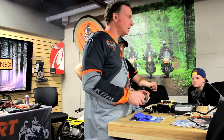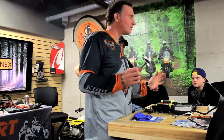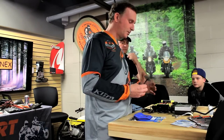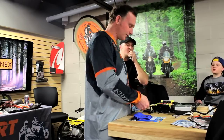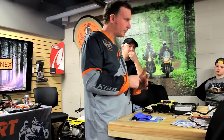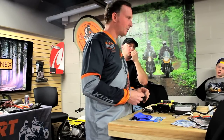Right? How about the sidewall? Yeah, that'll work on the sidewall. It's not recommended, but you're not going to do 100 miles an hour afterwards. You want to get out of there, right? It's a big patch on the inside of your wheel, and it's not going to go anywhere because it's held. Pull that through. Have some patience. Let the glue dry. Nip it off. Away you go.